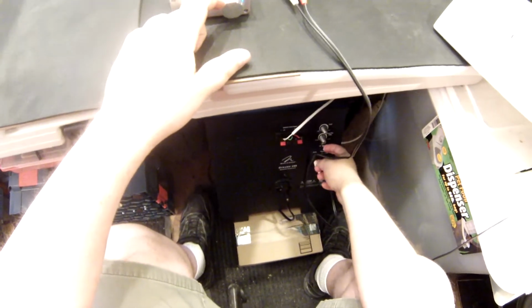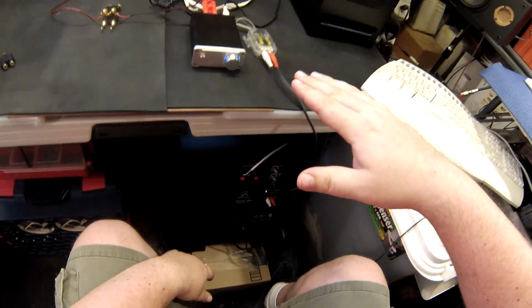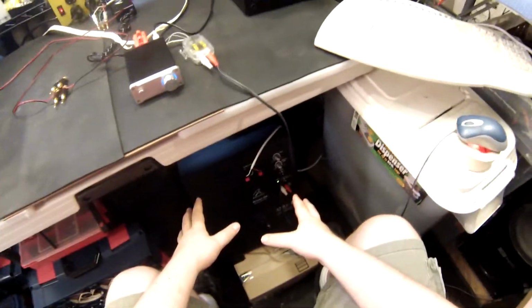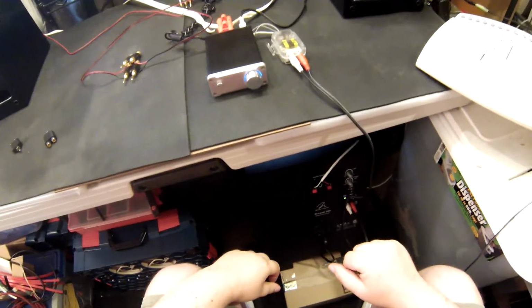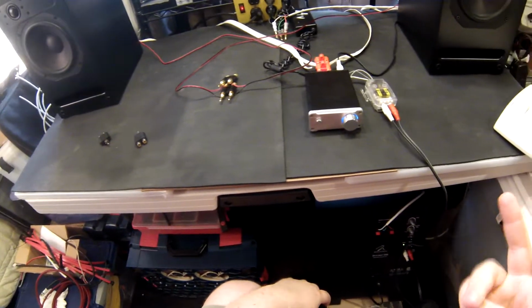And then of course you play with your phase. Phase just means when you hear a boom note. Phase 0 means the speaker's going out and in. When you have it on 180, it goes in and out. And that's a timing thing. If your sub is 2 feet further away, or depending on how the room reflects, you may have to switch that switch, or if it's a knob, adjust it. But those are the 3 ways? 2 ways? I don't remember how many ways I just taught you how to do that.